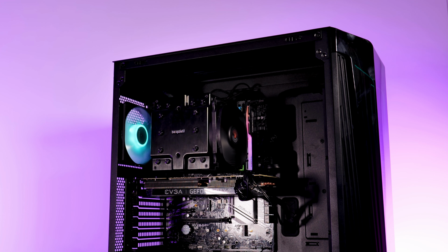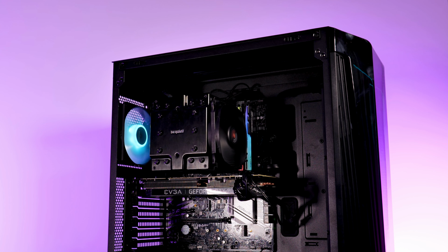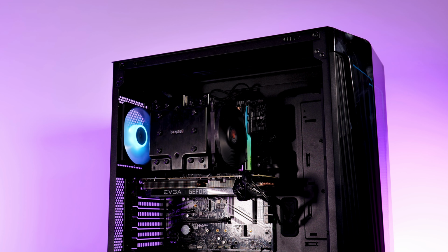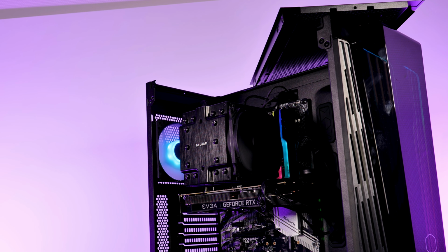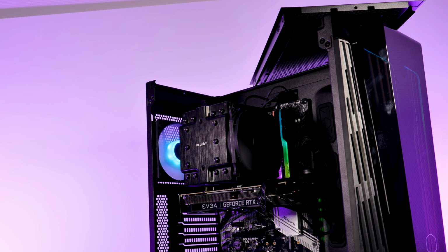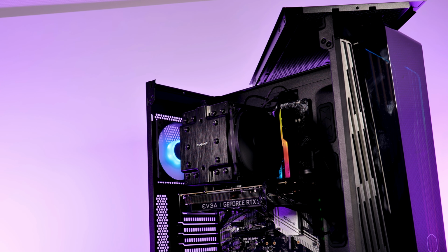But I'm still not done. It can also be a huge advantage if you're working with really massive CPU coolers. Let's take the Be Quiet Dark Rock Pro 4 as an example. If you would want to upgrade your current CPU cooler, let's say the stock AMD one, for something like this, you would never be able to do so without at least removing the GPU or maybe even the whole motherboard. Installing a cooler like this is an easy task, but to install it you need to screw it down before you slide in the central fan from either the top or the bottom, something that you normally are not able to do inside of a semi-finished build. With the MB540, however, it's really easy because you have all the space available above. And all of this creates a surprisingly useful building advantage, as well as providing you with a really easy after-build maintenance possibility. So really good job, Cooler Master.